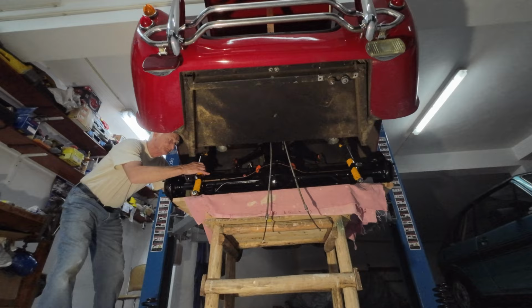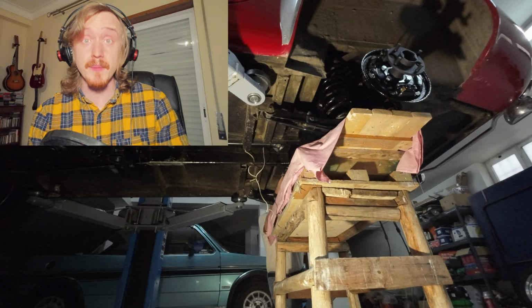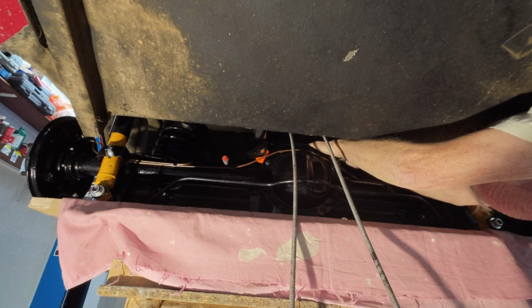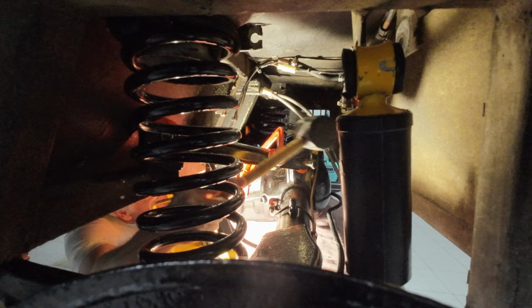And there goes the first nuts and bolts that hold the lower trailing arms in place. Plus, the springs and rubbers are installed in their proper place. Then, a tricky part, trying to fit the new bolts that connect the upper trailing arms to the mounting points on the center of the diff. They wouldn't go in without a fight.